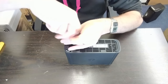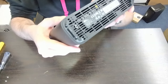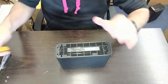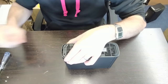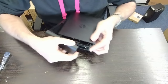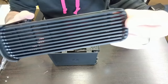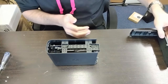If you mix up the three kinds of screws, you're going to have trouble reassembling the device. Now normally you'd be able to slide the panel out — you can see a little give at the top. This is where the flat-head screwdriver comes in. Just slowly insert it and apply the tiniest amount of leverage to remove that panel. Be very gentle here, because what you're removing is the entire top panel, which includes that mesh-ventilated section at the top.